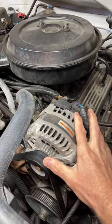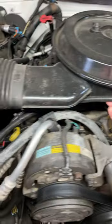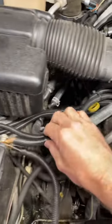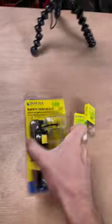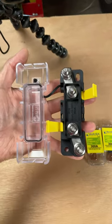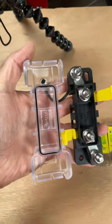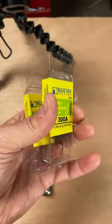A customer came in stating he just installed a high-amperage alternator as a professional job. You can see this really thick charge line going straight to the battery — only there's no fuse. So I'm going to install this by Blue Sea Systems. This is an inline sealed fuse block; you can see the gasket in the lid. I also got a 300-amp fuse, and an extra one to give them just in case.